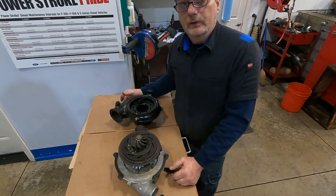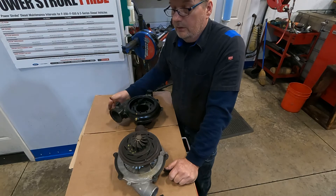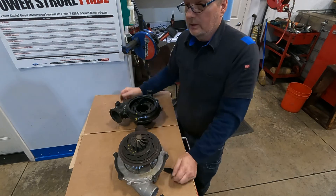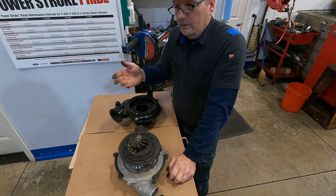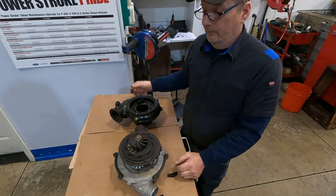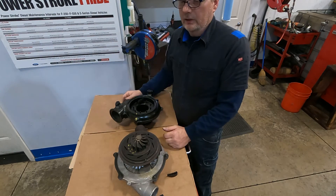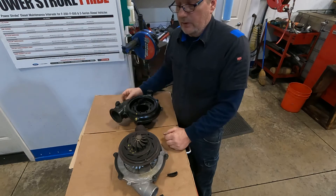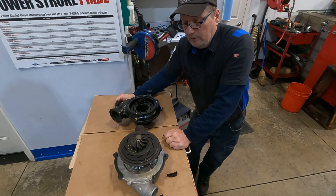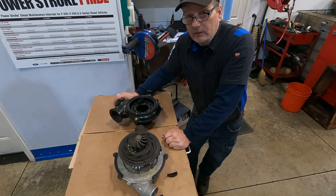That's how I test these before deciding to pull the turbo. Check your MAP sensor, your exhaust back pressure, and your barometric pressure — compare them. Do a quick test on the MAP sensor with vacuum and pressure and see if the PCM is calculating manifold gauge pressure correctly. You've got to do it fast because the PCM goes into fail management mode quickly when you start changing MAP sensor voltage with key-on, engine-off. Anyway, I'm going to pull the turbo off this truck, take a look at it, and if there's any question we'll get a new turbo and ship it back to the customer.